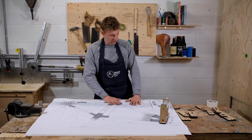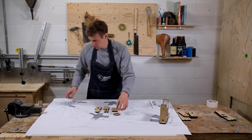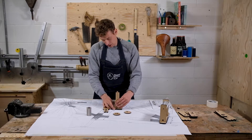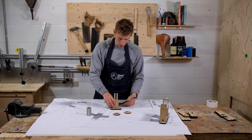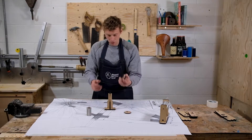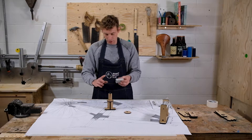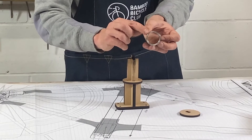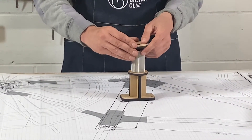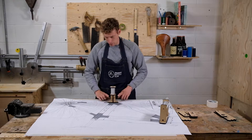Next step is the bottom bracket. You're going to need the following parts and also your bottom bracket — our specially knurled, designed one. The first step is to position these pieces here and here. This one goes on first, then this one slides over, and then we've got our lock ring which slides down and holds all that assembly together. The final thing is to fit the bottom bracket — this little mark is the drive side — so we position it at the bottom, slide it in, fit the lock ring to lock it all together, and then the base slides into place.